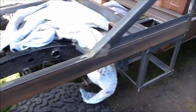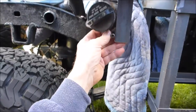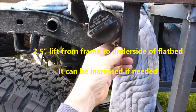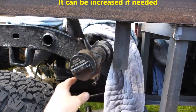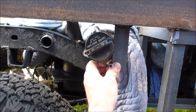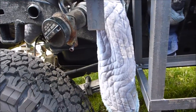Since then I've kind of relocated a gas tank nozzle — that's a tricky one, because the bed needs to be raised enough to give it an elevation change for the gas to flow downhill, and yet you don't want it down so far that it's going to hit the tire. A lot of angles to figure out. This piece is going to support a plate to protect the hose from any rock damage from the tires.